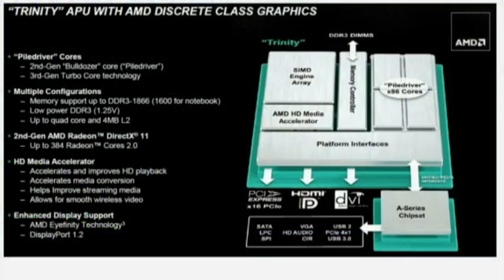After the full round of benchmark testing at PCPer, it's really not going to be that much different than Llano. The A8 series of APUs was based on Llano — the first desktop consumer APU available. Trinity really doesn't change a whole lot. When we first started learning about Llano, its CPU performance wasn't going to be great — the carrot on the stick was Trinity. Really good graphics on this chip. It is easily still the best integrated graphics you can get. Looking at the last two pages of the review — Borderlands 2 and Skyrim testing — it's about 20 to 40% faster than Llano.